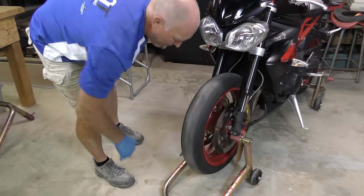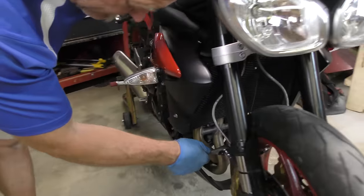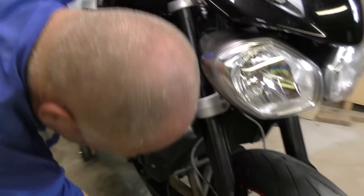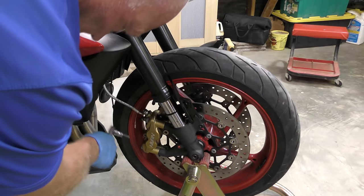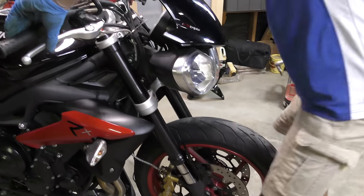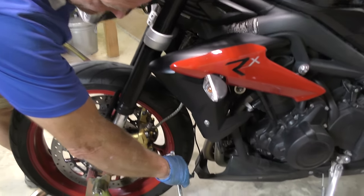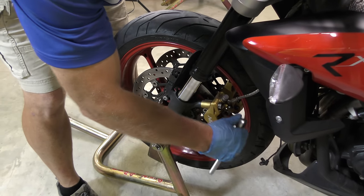Spin the wheel, hold the brake on, then go ahead and tighten the caliper. With the brake held on, do not release it — get it nice and snug, then you'll re-torque after the fact. When you change sides, just keep hold of the brake lever. You're not trying to put 80 foot-pounds on the brake lever, just keeping everything still. Step around to the other side and tighten everything up to guarantee the brake caliper and pads are all aligned to the rotor correctly.